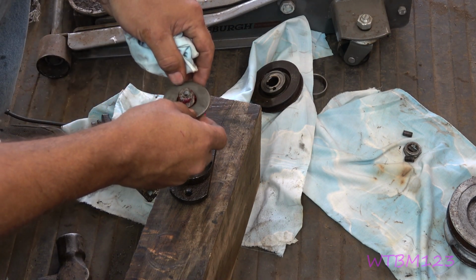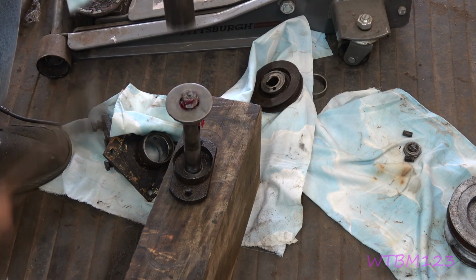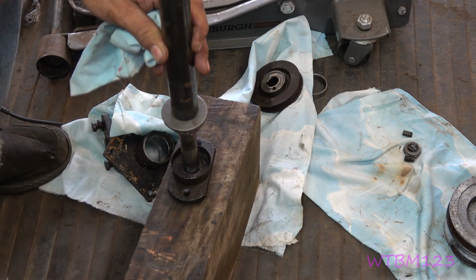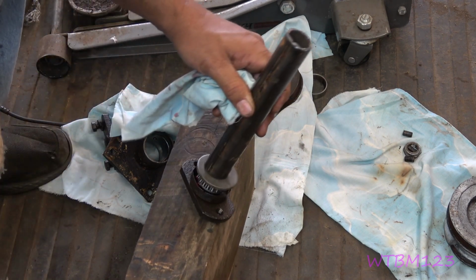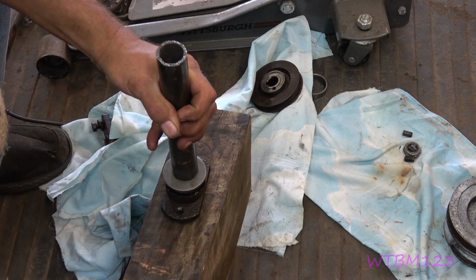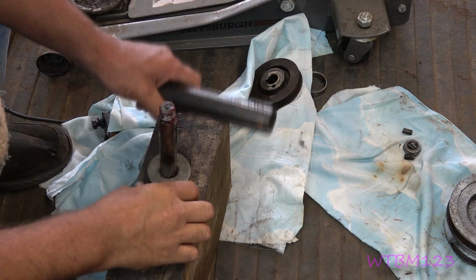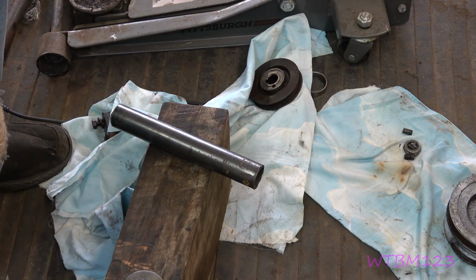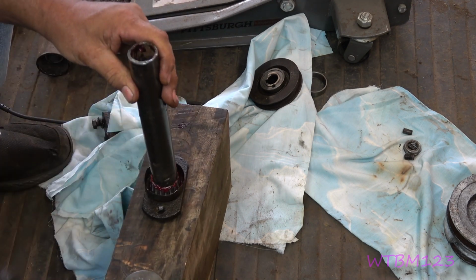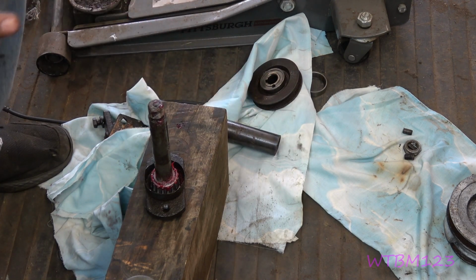The 1-inch piece of pipe is a wee little big. And I've got that washer, and my pipe's a little jaggedy cut, so you should be able to, make sure you've got the tapered part up, closer to the top, smaller. And then, see, I'm not all the way down yet. I'm close. I believe that's all the way down. Now you could take the pipe itself and hit it. You just don't want something too big and hit the cage. Sounds like it's solid, like it changed tone again, just like the race. So okay, that one will be okay.